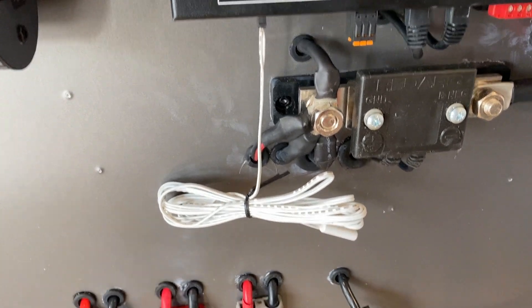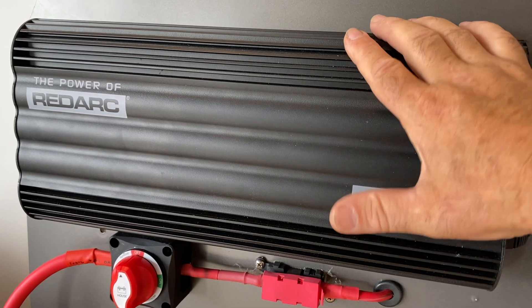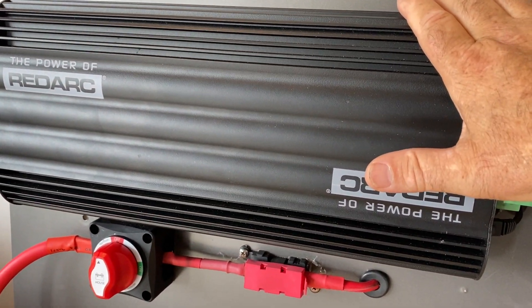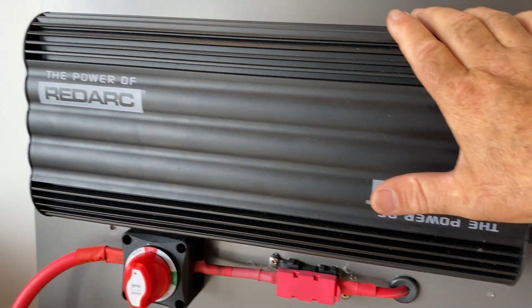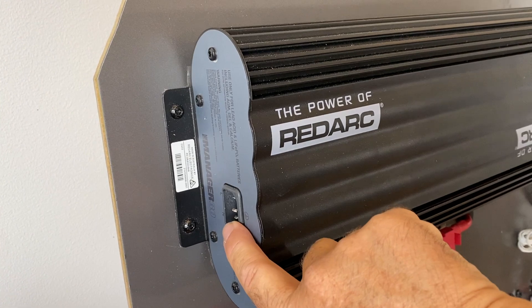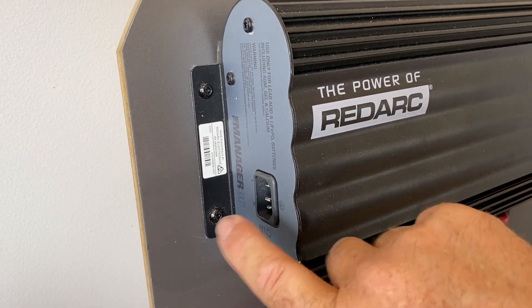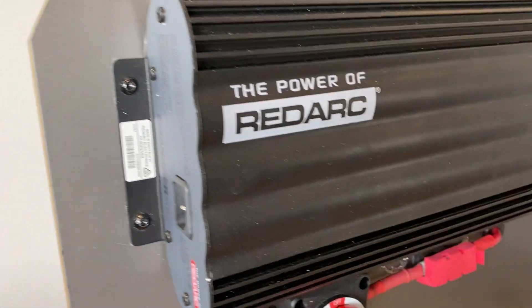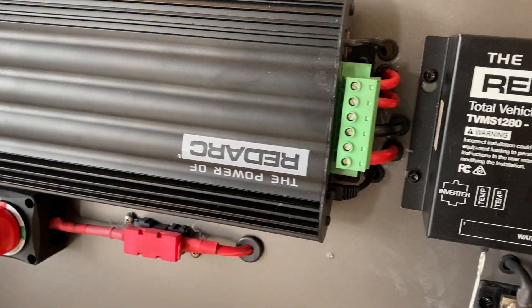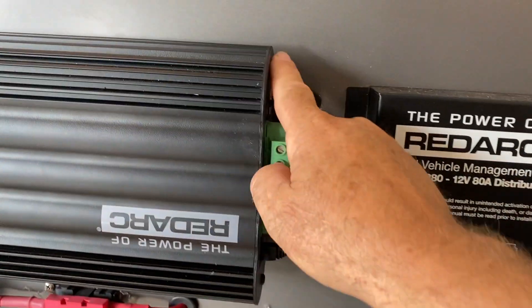Once that goes through the sensor, it goes to our negative terminal and then back up to our ground on the RedArc distribution box. The positive and negative are then transferred to the positive and negative on the battery charger. The other two connectors on the battery charger are our positives for our solar input on the camper and our charge from the tow vehicle battery. The negs on those I've put to the negative side of the battery sensor. So with that, the battery charger can decide what it's going to use to charge the battery - it will prefer solar power. I've also got a 240 volt feed, so AC shore power - when you come home or if you're at a caravan park, you can just plug into your shore power and it just works everything out by itself: when it's going to charge, what it's going to charge, and which feed it's going to charge from.